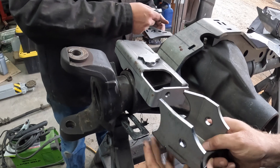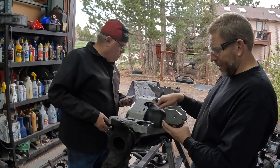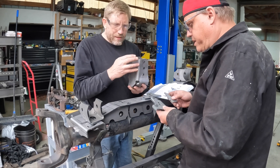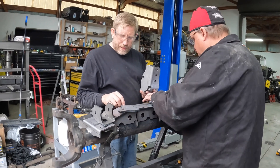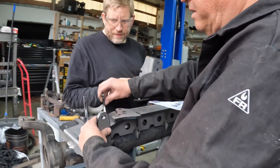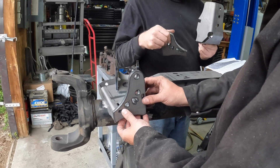When we're dealing with these Dana 60s and this swap kit, they do end up a bit wider than they would have been, because you've got a differential in the way. That's probably part 17. We'll figure it out — it's a jigsaw puzzle. Oh, 19 and 18 — okay, that makes more sense. So that sits like that. Was that for the sway bar? Yeah, this is for the sway bar, and this is the corresponding one on the other side.